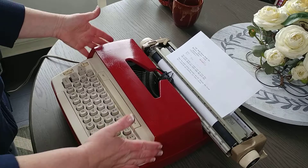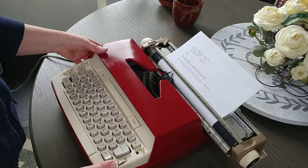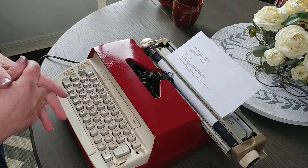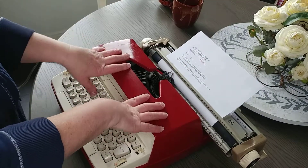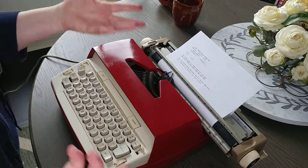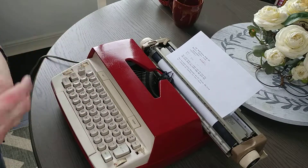If you push on this side it's going to hit against the motor; if you push this way it'll push it away from the motor. So if it does make a noise, it's only because the motor is hitting the side — this is really common to this style of typewriter. Just give it a nudge and the little squeaking noises will stop. Thank you so much.